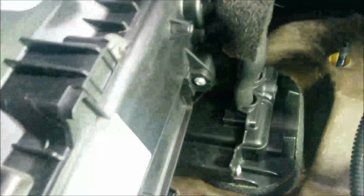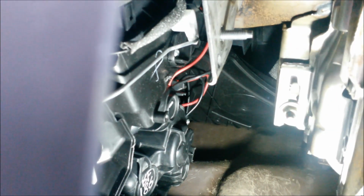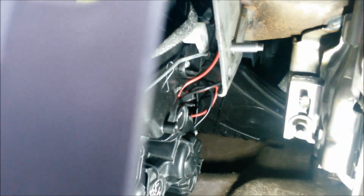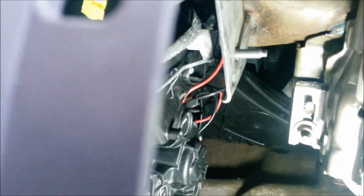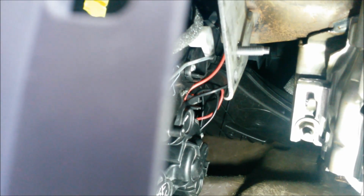Now we look up there, and there's the fan motor. So that's fairly straightforward to remove. Up there, let's see if you can see that. Fairly straightforward to remove. I'll get my finger out of the way by rotating it, but of course the problem is when you come to try and get that past all the obstructions, to actually get it out in one piece is impossible, or virtually impossible I'd say, without breaking the fan. I tried for 4 hours and that didn't work very well.